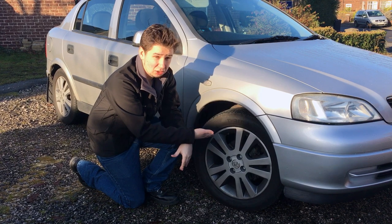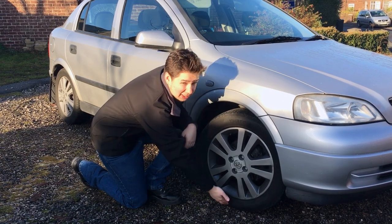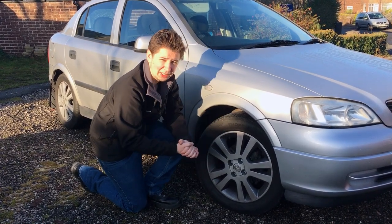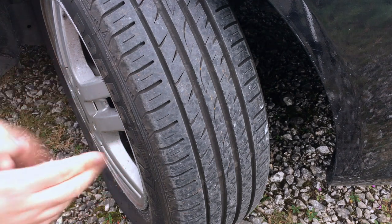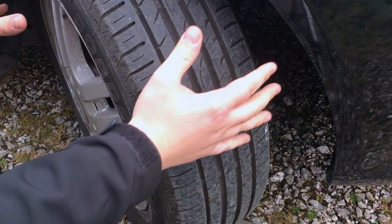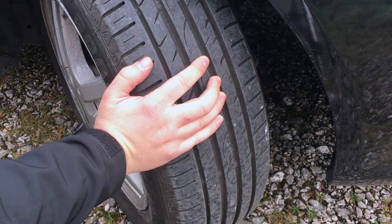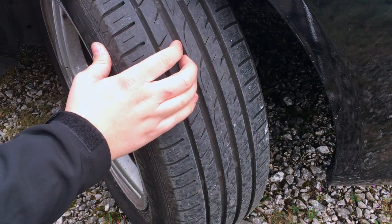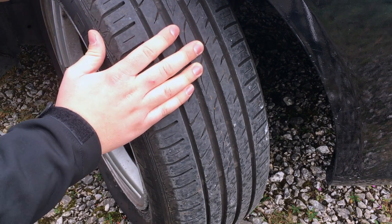As the cold weather comes in during winter, the pressure inside the tyre drops. So as it's going through late autumn and early winter, just keep checking the pressure on these tyres, because you'll come out some mornings and find it's actually quite flat. Check your owner's manual to see what it should be, get your foot pump, connect it up and just keep topping it up as it gets colder. The minimum tread depth for tyres in the UK is 1.6mm, but that's a minimum and really in winter that's no good — 3mm should really, for safety, be what you need, because these grooves in the tread are designed to help water disperse away from the tyre, which means your wheels don't aquaplane. In wet weather, your car keeps contact with the road. Remember, these four pieces of rubber are the only things keeping the car in contact, so make sure they're in as good condition as possible. And if you're more serious, you could even consider fitting winter tyres — below 7 degrees Celsius they provide a lot more grip than summer tyres, helping with acceleration, cornering and braking, making your car safer altogether.